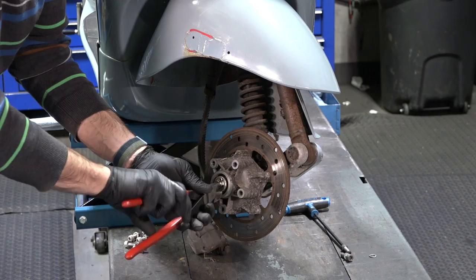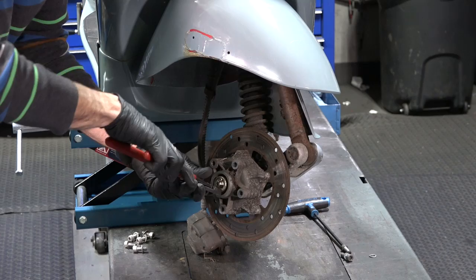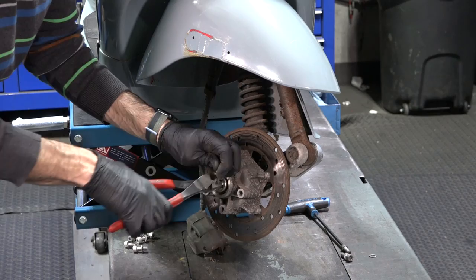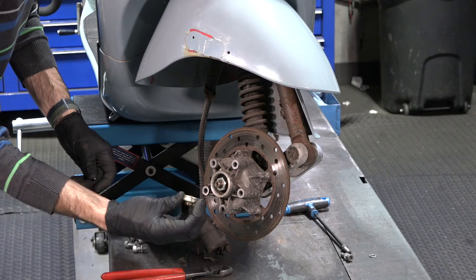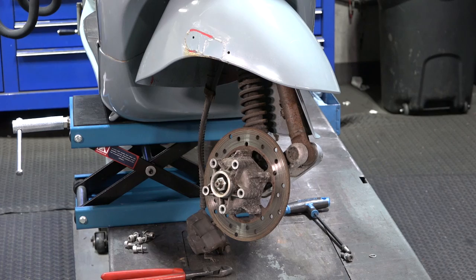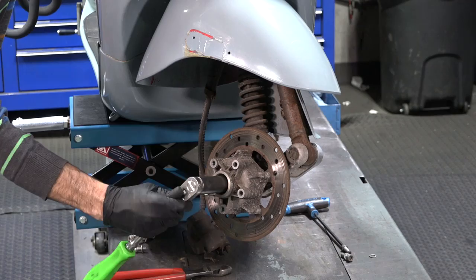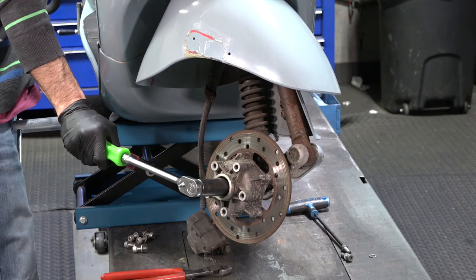This is the easiest way you could remove a cotter pin. This is the axle that supports the wheel bearings of the front end. Take this stuff off. I covered this job in a prior video a couple of years ago, but I figured do it all together now that these scooters are at the age where they definitely need this kind of service. Take that little castle nut right off, throw the cotter pin away. Part number 012789-B is the correct cotter pin from ScooterWest. Get your 22 millimeter socket, and you could also use an impact — that would do the trick just as well.